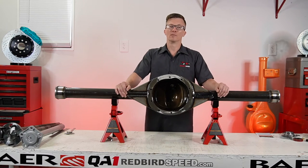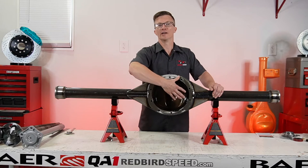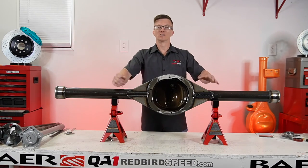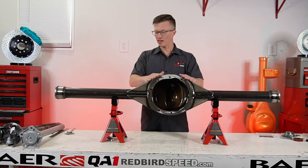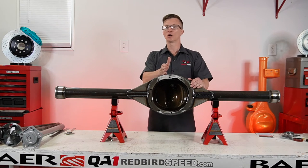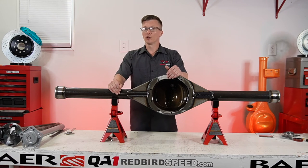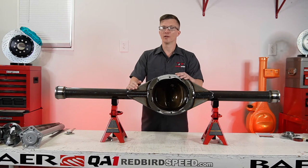One other perk from the M9 is the faceplate location. You have an opportunity to have a faceplate that's drilled so that the opening is offset. What happens there is you can center up the housing, the center part of the can, in the tubes, have an equal tube length on both sides, yet run that drive shaft right down the center of the chassis. That is really nice, especially in a drag car. It gives you a lot of real estate to work on the tubes and center up the drive shaft. A very nice feature on the M9 can.